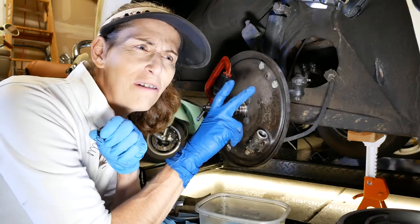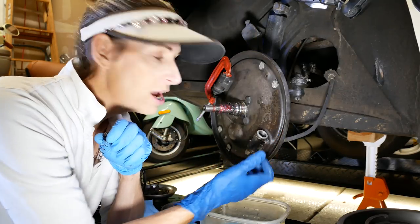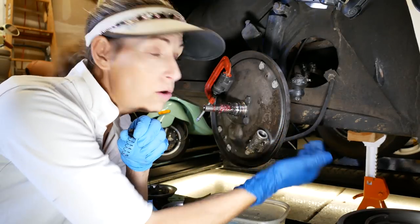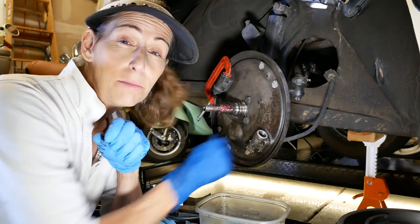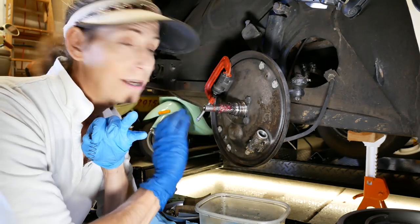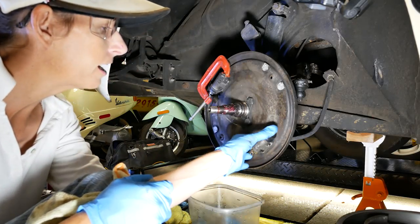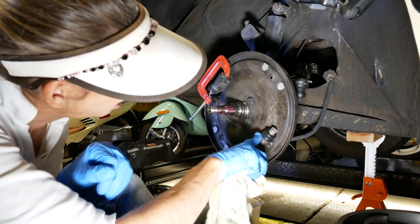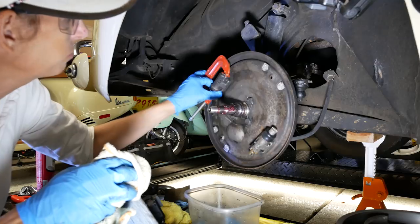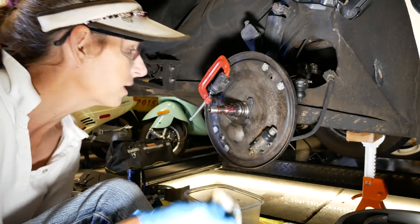I think I need to bleed this anyway - it'd be great to bleed it a bit while it's exposed like this where I can actually see it, and then I want to see if I'm leaking at all. I'll clean things up, put the piston back in, and test it. We've tested this with the clamp on and it appears to be dry all around - that's a very good sign. I'm hoping we're in a good place. I'm going to reassemble the rest of the brakes and I'm not sure what else to do at this point.